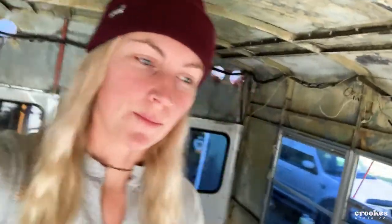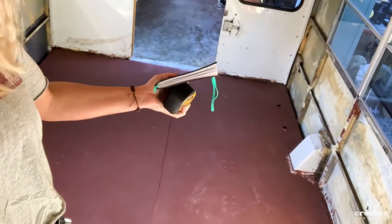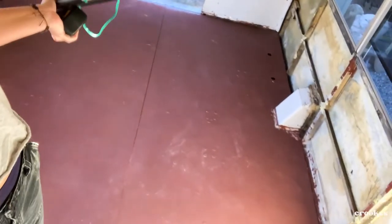They come in 4x8 sheets and this bus is 7 and a half feet wide. I'm going to cut some foam today — cut insulation to put underneath the subfloor. The plan is it's 7 and a half across and these sheets are 8 feet long, so I'm just going to trim them down. I'm going to stagger the first one because we want the subfloor and the insulation to be staggered so that there's no thermal gap — so it kind of distributes it. So I'm going to make a 2-foot insulation board for my first piece.